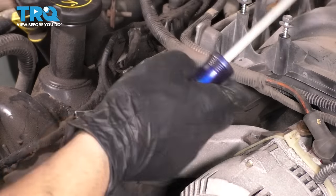The torque for this is 18 foot-pounds for all these nuts here, and you start from this one over here, so you start at the back, move down, and then go to this one, move down, this one down, and so on both sides, so regardless of which manifold you're doing, it's the same torque spec and sequence. And then afterwards is when we're going to bolt it onto the pipe. But you want to make sure, since this pipe can move around, that the manifold is pressed tight up against the engine, seals up, and then we bolt it up here.